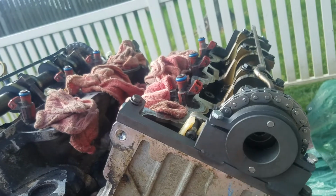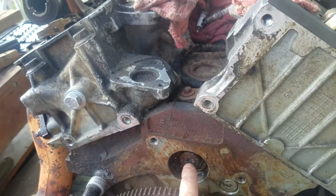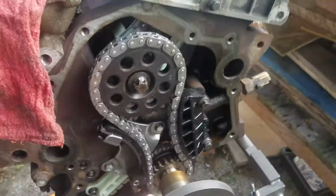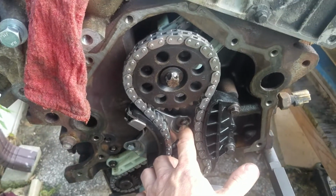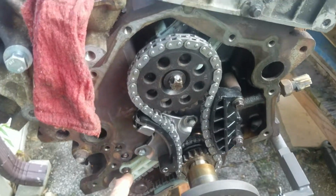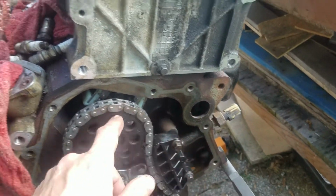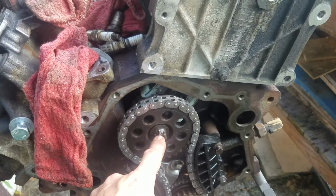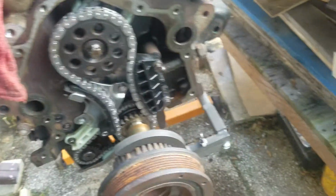I try to do as much research on doing timing chain cassettes as possible, and it says this one, so this one's been replaced. Torque this one down. I had trouble with these little ones here, so I had to go get new Class 8 hex nut ones, and we're able to torque these down to 8 foot-pounds. This is 8 foot-pounds, 8 foot-pounds, 21 foot-pounds for these. The one behind there is 21 foot-pounds. This one's 63 foot-pounds plus 90 degrees. That's a little tweak, right?